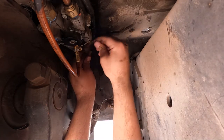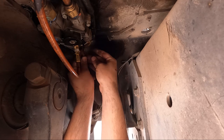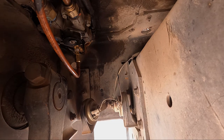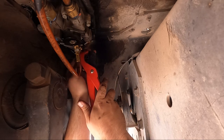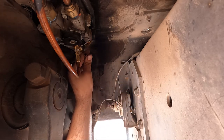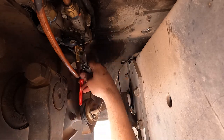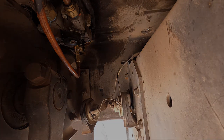And this is the other part of the pipe, other side. Trying to get all the junk off of that one also. And this is a great candidate to actually get cut back just a hair, so it's really rough and not an easy thing for that ferrule to grab. So I'll be right back. So this is just a PEX pipe cutter, but it works pretty good for this. Just cutting off the affected area. Next step is to start it back up and check for leaks.